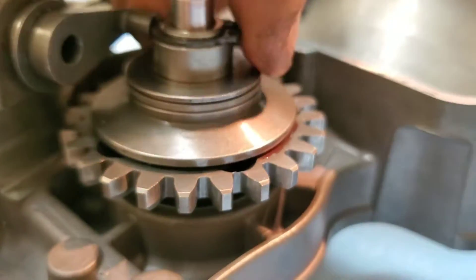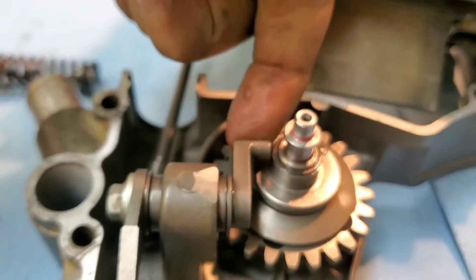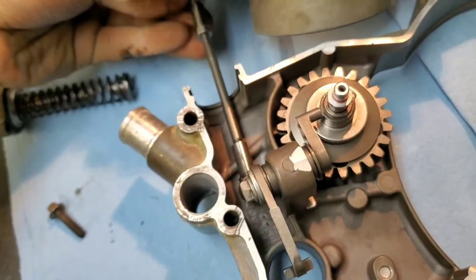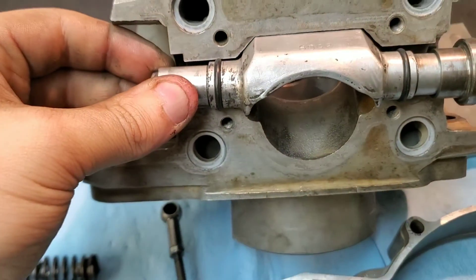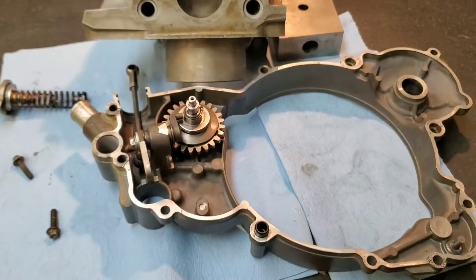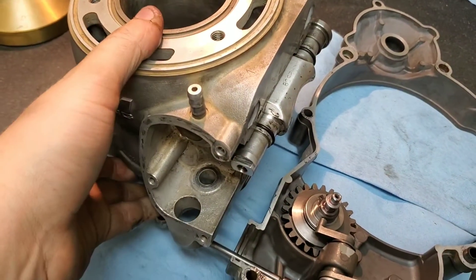The balls are pushed out, they lift this piece up, and that moves this rod — moving our little rod up like that and opening up our power valve. So that's how a power valve works in a two-stroke engine. I thought somebody else may find it as interesting as well.